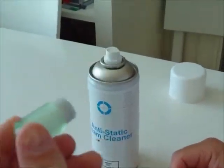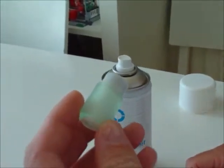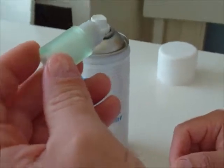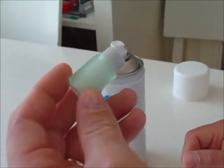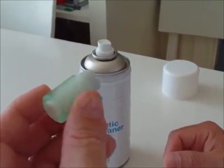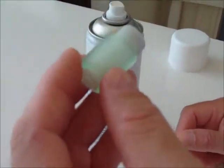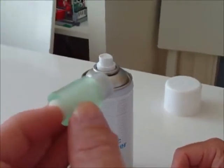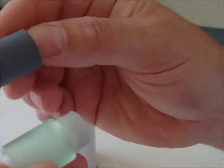Now, I've been having very good success with these tires in my Saturn based machines. Traditional tires in some of my high volume accounts, I'm lucky if I get 200,000. These will actually go probably around 400,000 before you actually need to replace them. Now they can be cleaned, and you'll see that if you're dealing with a lot of paper dust, these seem to perform a little bit better than the Kyocera rubber wheels. Now, as you can tell, that one was a bit worn out. I just saved it as a demo.